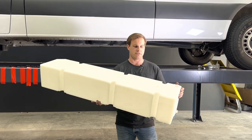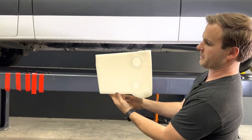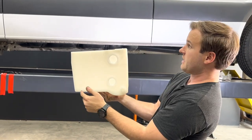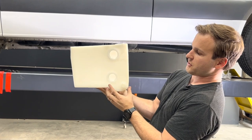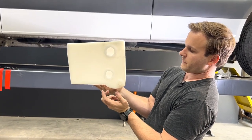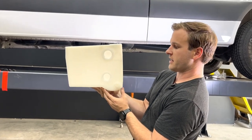The first thing you'll notice is this tank is sloped. We did that because it's a really nice visual when you look at the outside of the van and you don't see the tank. It slopes inward, and all the water is going to collect on the lower portion, so if this is the feed going to your pump, you're getting all 22 gallons out of this tank.